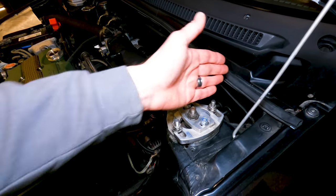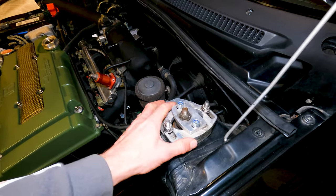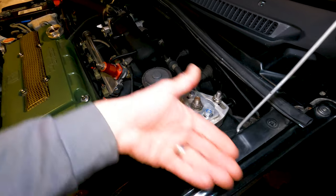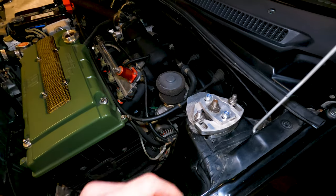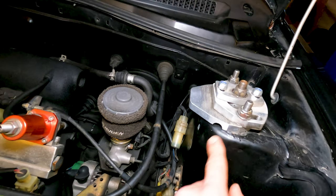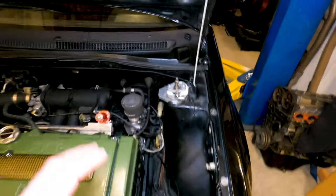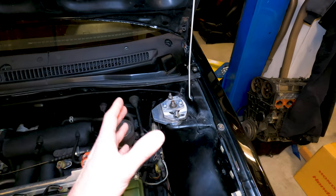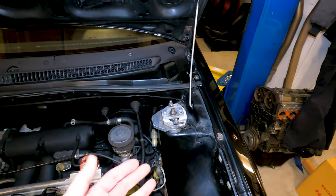Farther in or out will give us more camber; farther back and forward will change the caster angle. On an 88 to 2000 Civic, you actually have a shock mount here, not a strut mount. Those cars have a double wishbone suspension, so there's a control arm up here that controls the camber angle when you move in and out. On these cars, it's a strut. When I get down in the fender, I'll show you the difference between a shock and a strut. You can see here that on this upper mount there are no other mounting places for a control arm, because there is no upper control arm in these cars. The upper mount situation here is more similar to an EP Civic, 02-05, or newer — FA5 or anything with a strut — as opposed to a shock.